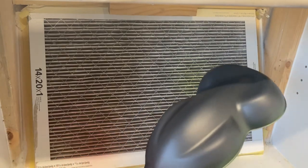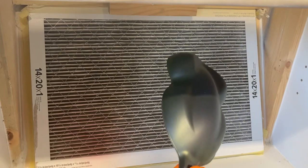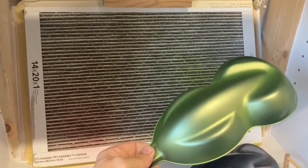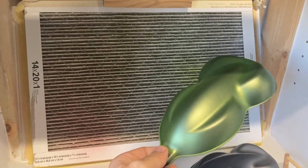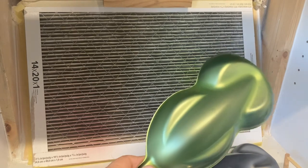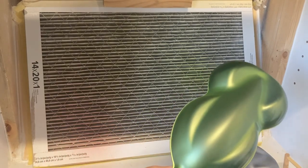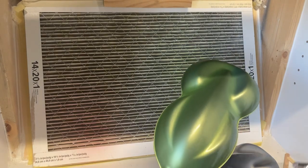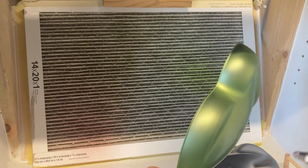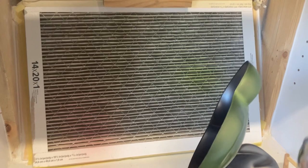We have loaded up the 0.8 needle and nozzle combination. I'm using Wicked Lime Green Pearl — spraying a pearl with very little reducer, about 5%, to get that coverage in there. Then I cleaned the cup real quick and am now spraying UVLS high gloss with the 0.8 needle and nozzle. You're seeing this in real time how I'm laying it in there with the airbrush. That's asking a lot from a round pattern airbrush to paint a shape this large with a clear coat and expect it to come out smooth, but with that very large needle and nozzle combination I felt pretty confident we could get a reasonably good finish. I'll show you guys what it looks like when it's dry a little bit later in the video.